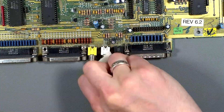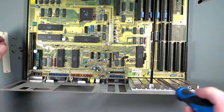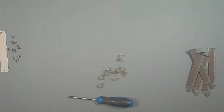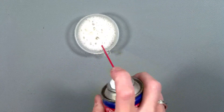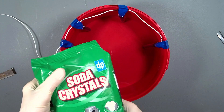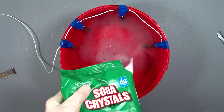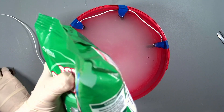For the rest of the pieces however I'm going to use a different technique. First I'm going to remove all of the back planes and screws from the case. The screws I'm going to put in here and spray some WD-40 on them and leave them to soak a little. I've got this tub here with four sacrificial anodes - each one is a carbon rod. Now you can use steel here, not stainless steel, but carbon rods work better. The water's warm, not boiling, and I'm just going to add some soda crystals, these being sodium carbonate, which help reduce the resistance of the water.